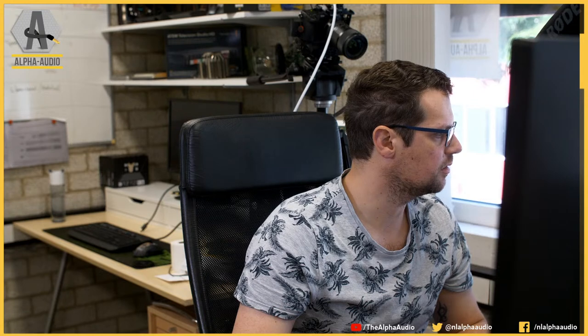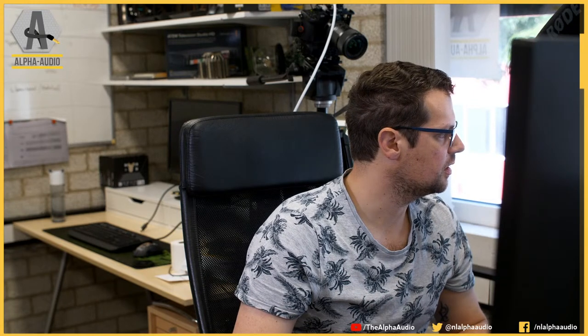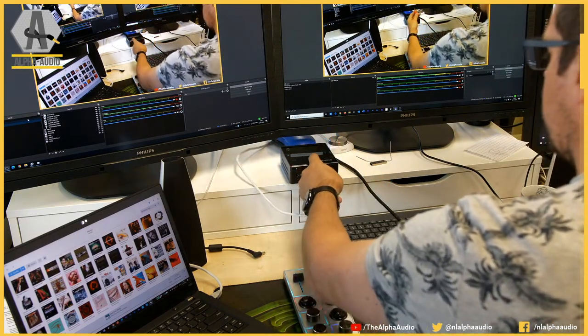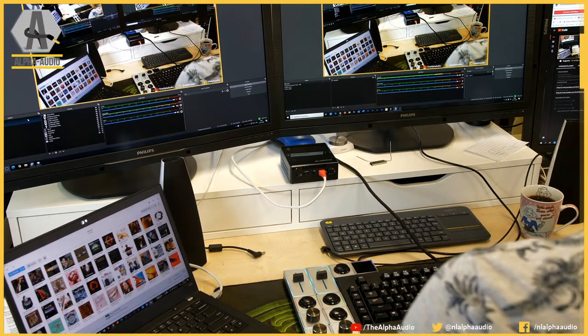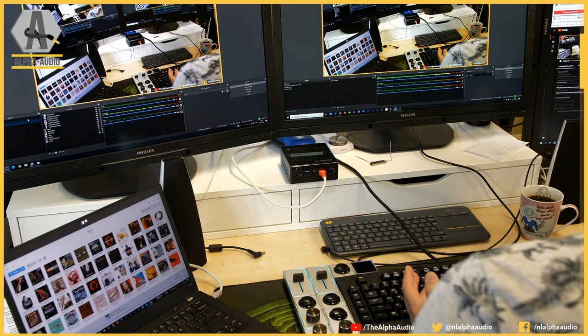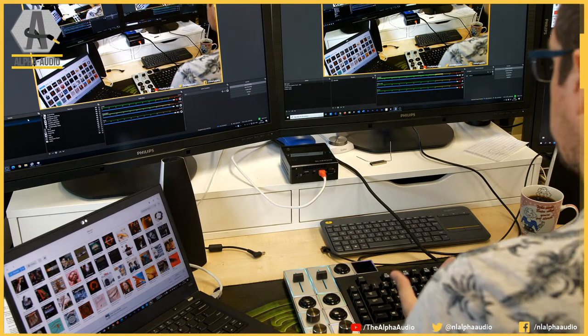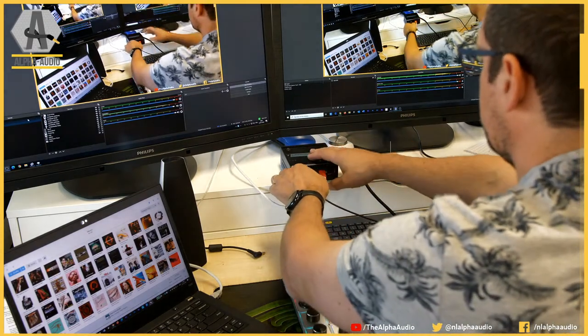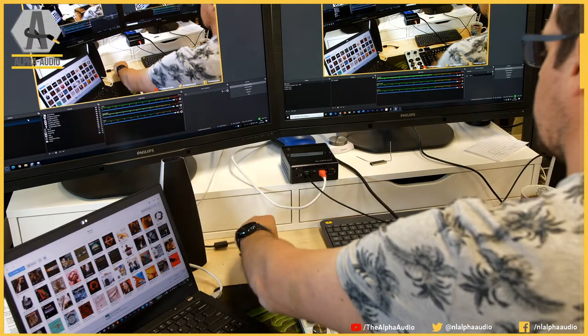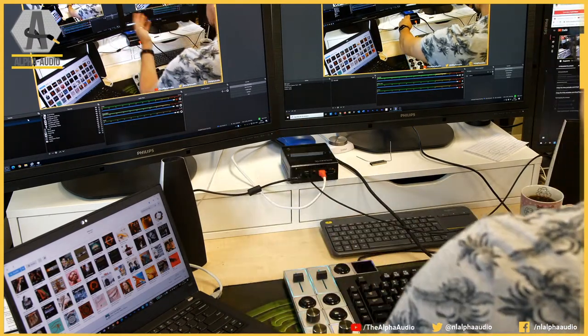You need to connect it to Ethernet, of course. So let me show you how you do that. Let me see, I need this camera for that. Okay, you need to connect it to Ethernet. I strongly advise you to use a cable, especially for the NUC, because it has to serve all the zones, so all the endpoints. In this case, we plug in the screen because we need to do some stuff on screen. Of course, you need to use power, so we put it in there.